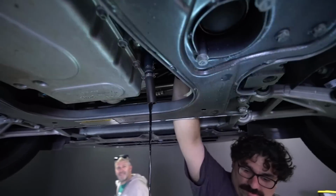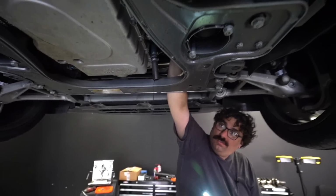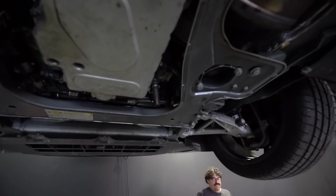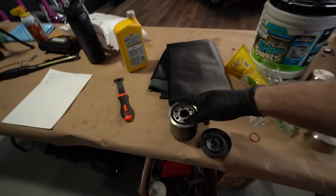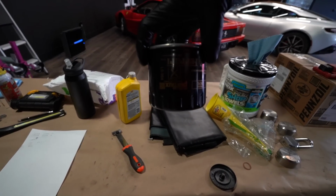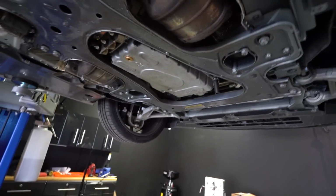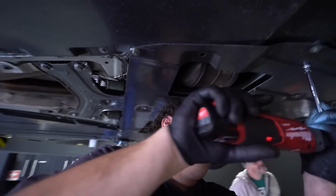They have that nice drain hose, so it just drains down really nicely. So just like dumping oil all over the place. Ooh, there it goes. That was hot. The oil wasn't hot at all. The filter, though. All right, well, got the new filter, rubbed some oil on the seal, and these get tightened down to basically a half an Ugga-Dugga. All right, that was pretty simple. Now we just gotta put the bottom panel back on. I will say this has so far been much easier than the 430s, and the 458 for that matter. All right, just kind of button them all up.